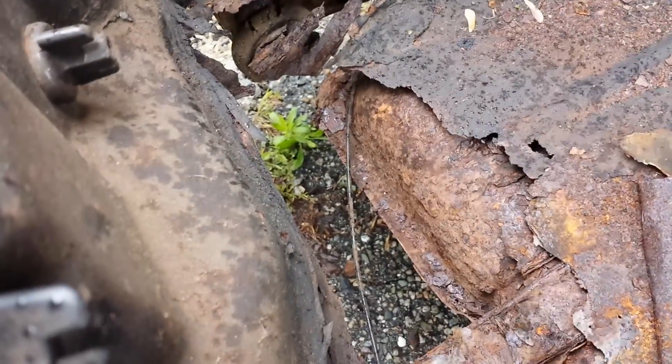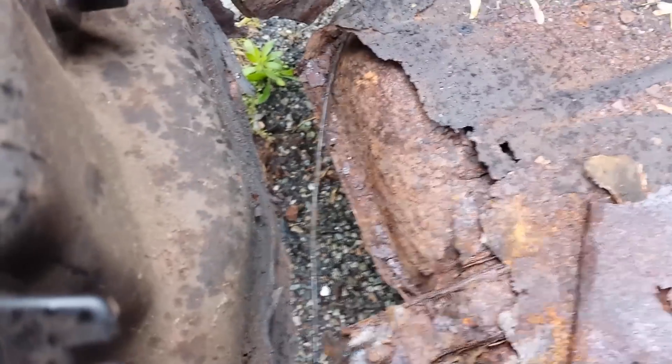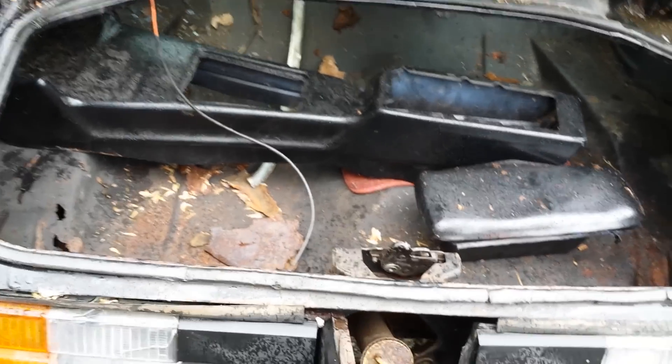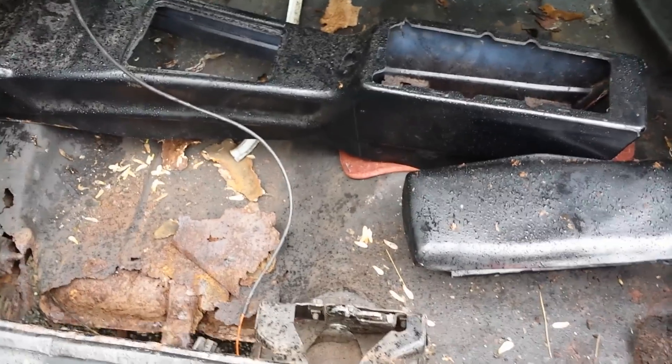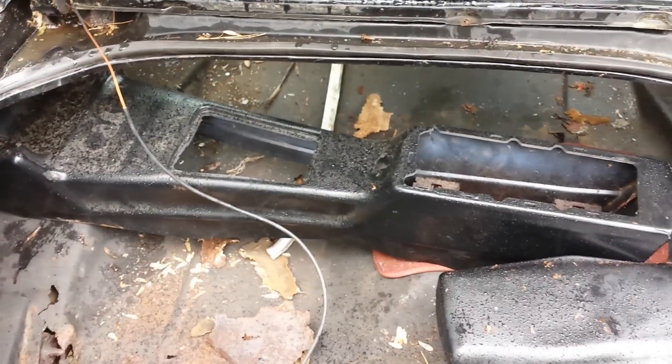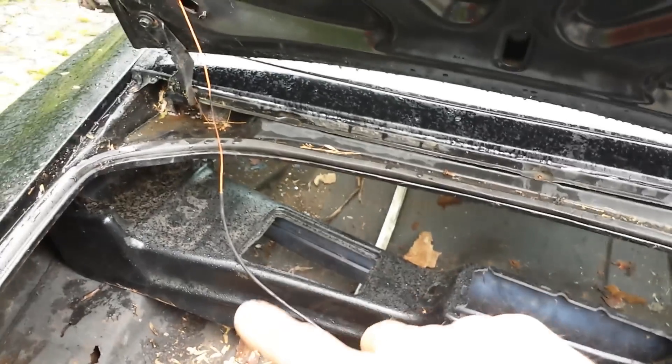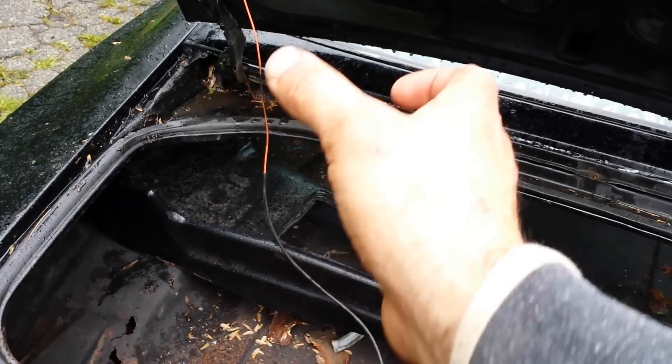For the leaf springs down below, all this has got to get peeled out. Tank's coming out. This might be narrowed — we might have to narrow the rear end, might have to mini-tub it. A friend of mine who works for an auto body shop suggested you just take an existing wheelhouse and lop off three inches, add a little strip and move them over. Or you can get the aftermarket wheelhouses, the tub kits, but that's a lot of money.